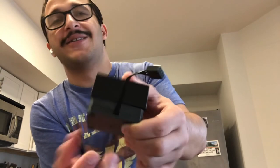There's automatic drainage, and you see it on the roads. If you're walking on the sidewalk, the road goes down where there is a drainage hole, and the road actually does tilt in towards that. So if EK designed it to tilt in towards the bottom, but also had this wire coming out of it, one, you wouldn't have water coming in. Two, if you did have water coming in, it would have escaped and evacuated automatically without building up and ruining a $100 pump.